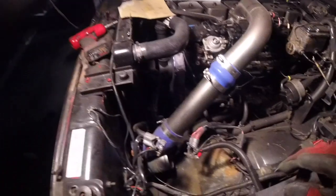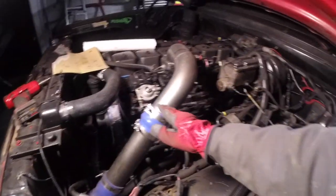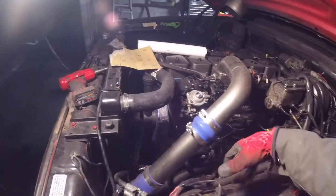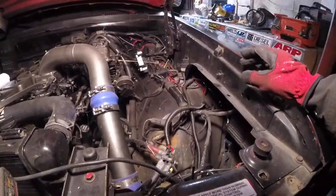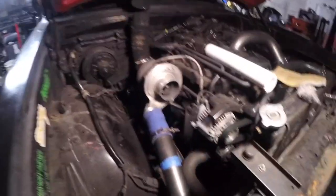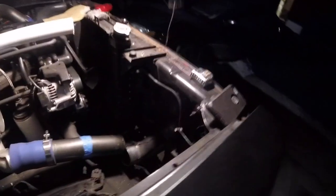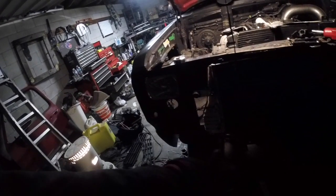Just bending this, we hit where we need to, so this will probably just need to be cut and shortened a little. We'll need to order two 3-to-3.5-inch 45-degree elbow intercooler boots. For the most part it looks like it hits pretty much dead on. I don't think I'm going to put the battery tray back in — I'll probably make my own framed battery tray and mount it over here, taking height into consideration. The other side matched up too, so we just need to order a 45-degree boot. Now we're going to take the intercooler out and clean everything up front and tack weld in these brackets.